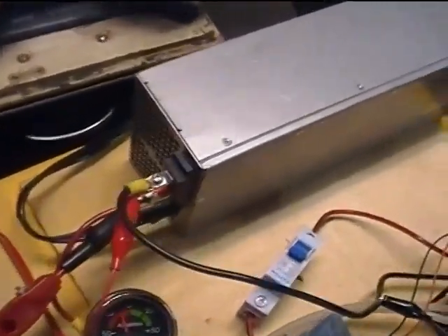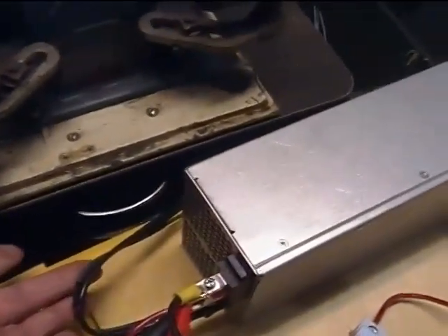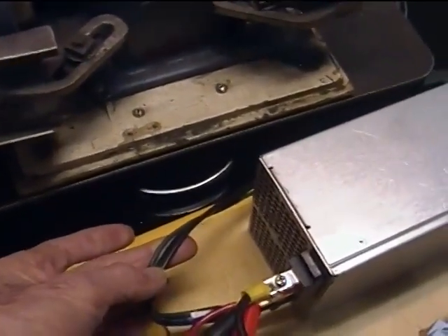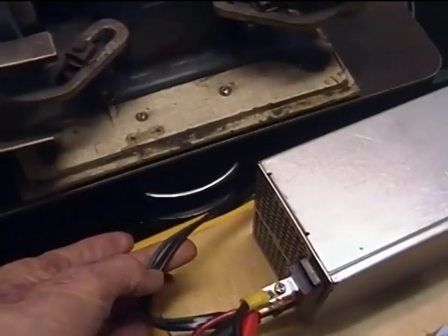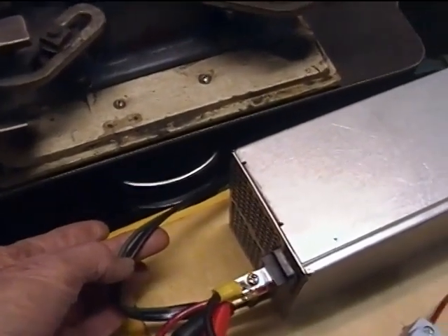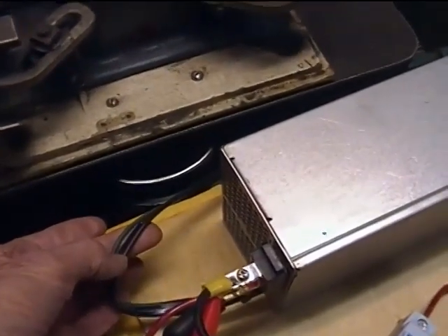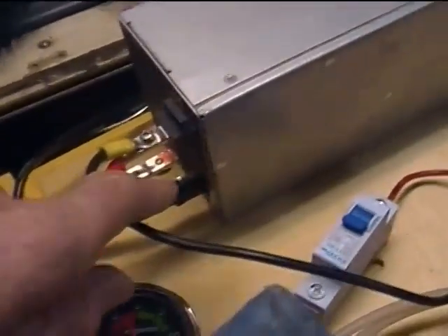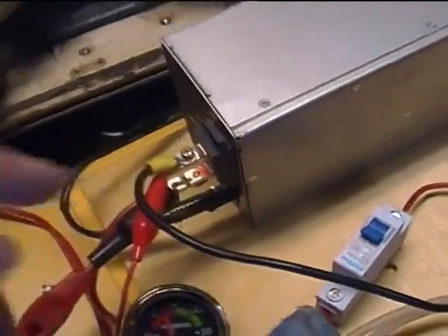It came with a two conductor power cable and a two pin US non-grounded plug on the end. I took that off, put a 250 volt plug on it, added a ground lead from a pin that's way down in there, and hooked it up as you see. Sorry that it looks kind of messy.